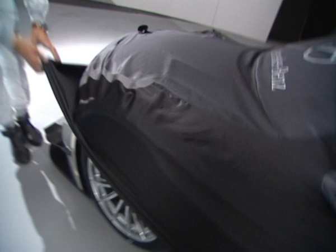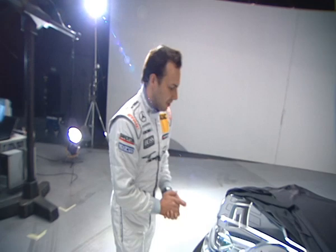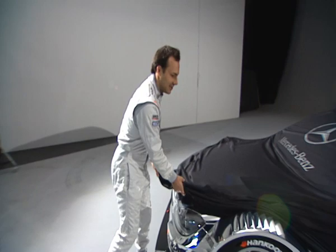Let's have a sneak under the front. You can see the front of the car here and the biggest difference is the wheel arch. We've got a very big wheel arch this year because the tires are wider than last year. We have a wider tire with a bigger sidewall, so more mechanical grip from the car. That's all we can see of the front.